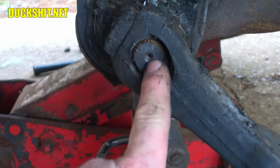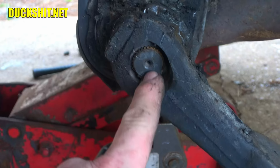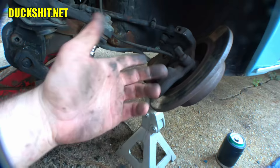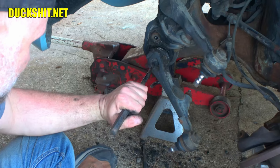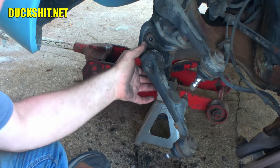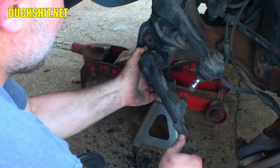I'm going to use a softer, gentler tool to knock it out of place. As I was wiggling and tugging on it, it quite surprisingly shifted in the opposite direction. The moral of the story — don't turn off your camera when doing something difficult, because weird stuff is going to happen. But it's moving on the splines now, which is good. I gently tapped the torsion bar back into the trailing arm with a drift, and the whole arm came off in the opposite direction — defying the laws of physics. The whole arm is ready to come out.